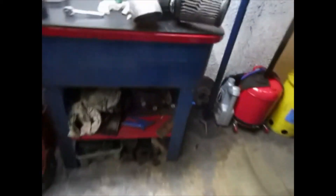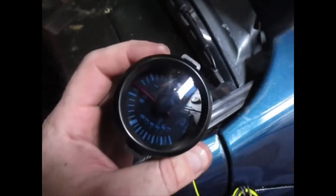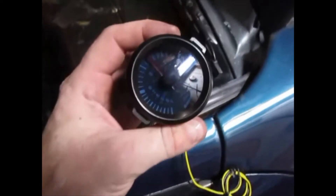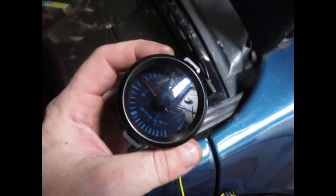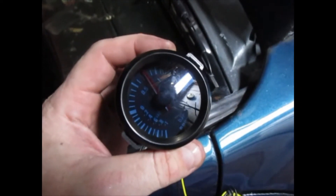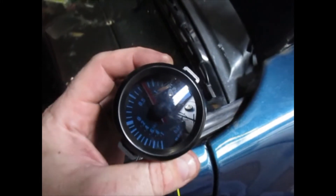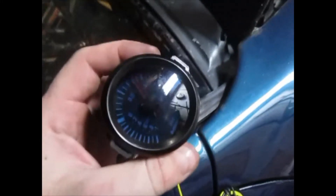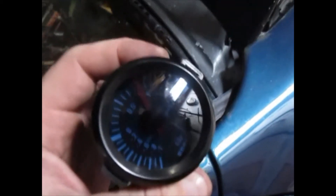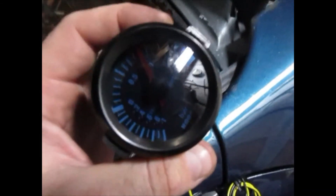Notice there's no leaking here. The bolt is back in the tube. None of the clamps are leaking, and now we're going to crank up the boost. Crank it up a little more. I got 9 pounds, 10, it's going up — 11, 12, 13. We're going to take it to about 17 or 18 because that's more boost than I'll probably run. That's 14 pounds boost. Keep going — 20 on the gauge over there and 14 over here.